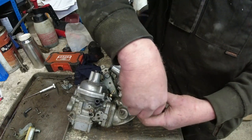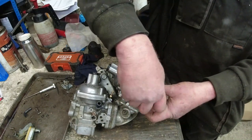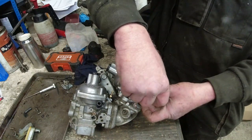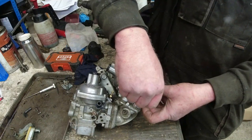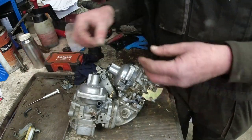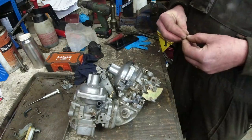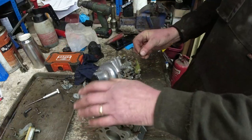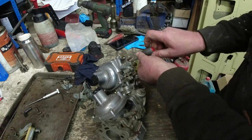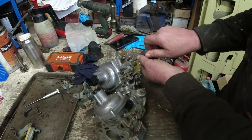So if we count through the faults we have with these carburetors: I don't think the diaphragms were particularly good; the throttle butterflies were certainly not very good; the float heights were both set incorrectly; the jets were set incorrectly such that it was very difficult to tune the carburetors; and the choke modules — one was incorrect. So it was a bit of a catalogue of disasters really. But let's hope now that these go back together and behave.